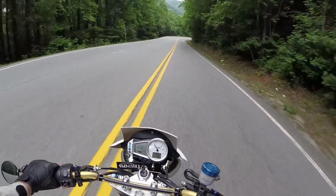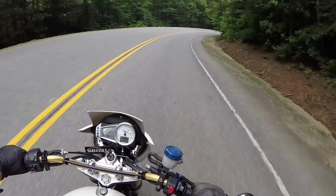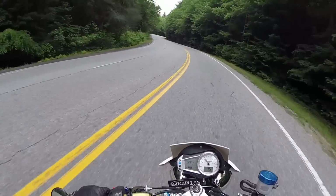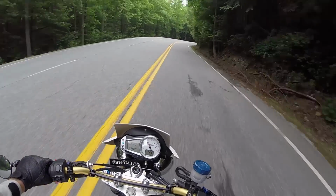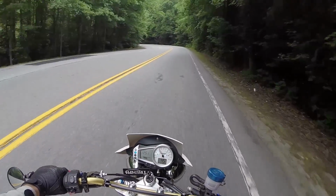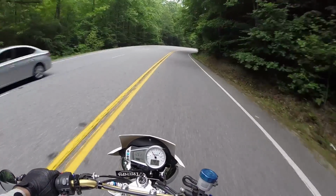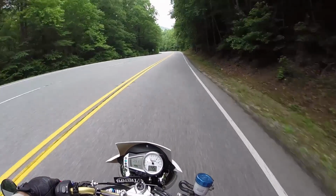So let's look at this. I'm speeding up, and now I'm going to go down through the gears. You see that? I did that a little bit in the last video, that's called rev matching. That is imperative for good progress on a curvy road, because if I don't, let's say I miss the rev match, all right? I'm going to downshift here. Oh. Did you hear it just kind of hit? Here, I'll do it again. All right, I'm going to downshift. Wait, hold on. I screwed that up. I'm so used to rev matching.